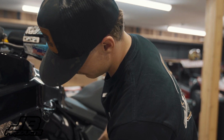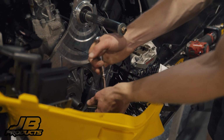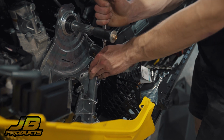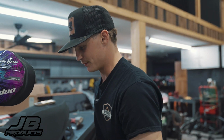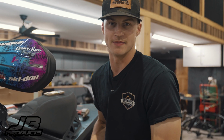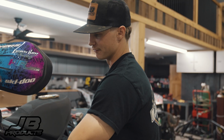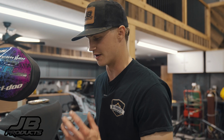And then that nut, you'll have to go back and tighten the nut down after, either if you can fit a socket on it, depending on if you have your motor and whatnot torn apart, or just use a ratcheting 13mm wrench. You can get in there and tighten those nuts down after the fact, but you can run these screws in as long as your threads are still there. You can run the screws in, tighten them down, and you wouldn't even necessarily need to have the nuts on the back. As long as the threads are in here, but that nut will add that extra security and keep everything tight in here, and for sure you'll never lose any part of your E-Mod over on this side.